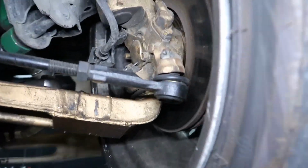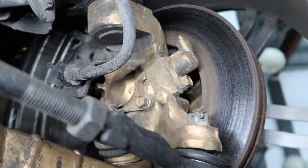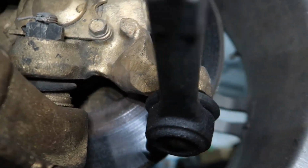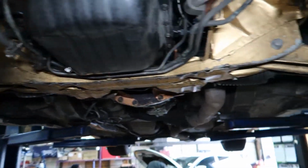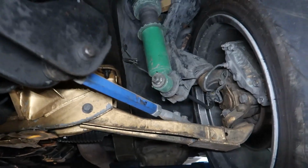And then I've got cut and shut knuckles, which are pretty much drop knuckles. I don't know if you'll be able to see the weld marks on these. No, you still can. So you can see right there, they've been welded and moved, which gives the car a lot more lock and makes it feel very, very twitchy, very responsive. If you're doing a drift setup, especially, R chassis don't tend to have the best lock.